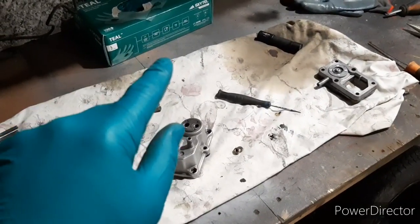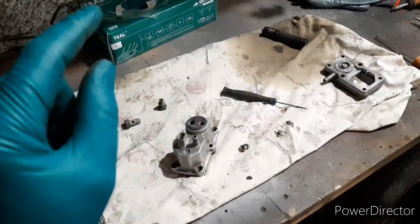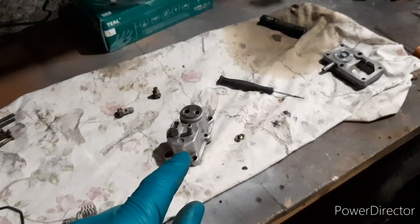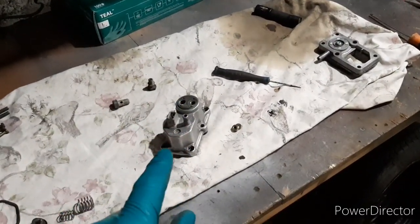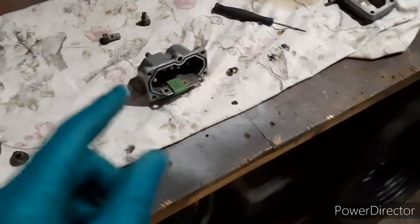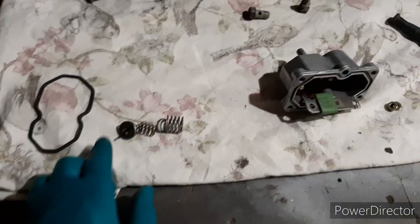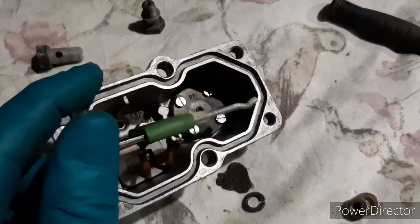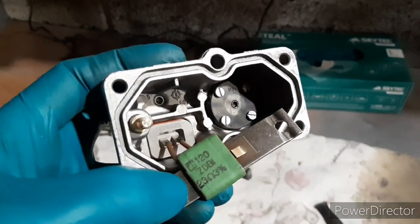On the control plunger inside, there's pressure on top so the plunger can be held inside the fuel metering head via fuel pressure, which comes out into the lines and goes through this. There's a bimetallic strip inside that little bar with a green bit on it, and there's a little top hat with a pin on it that sits on the center of that black circle inside.